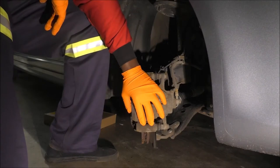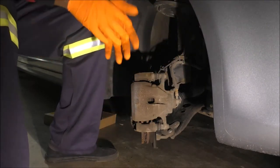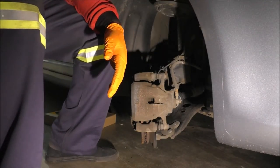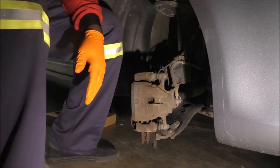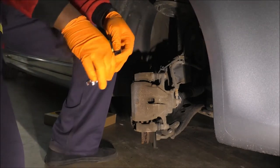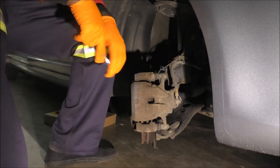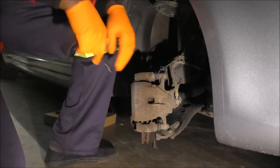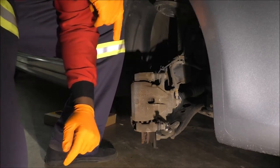Here it is. This is your brake caliper, again, bracket, rotor, you've seen that. So what I want to do right now is just keep working as fast as I can, and call out the tools I'll be using as I use them. And I'll also do my best to call out the alternatives. So if all you wanted to do was replace your brake pads, the caliper is what you need to loosen. You can do both the top and the bottom bolt. This one here, 14 millimeters.